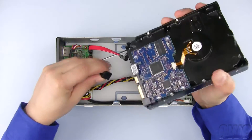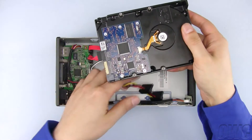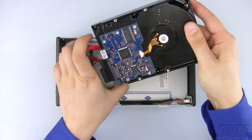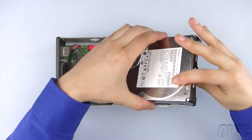Installation of this hard drive is easier if you turn it and the wires upside down to plug in the SATA connector and power cable. Now turn the drive right side up, lay it in place, and make sure that this heat sensor wire is not underneath it.